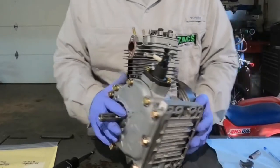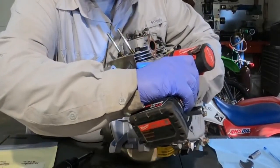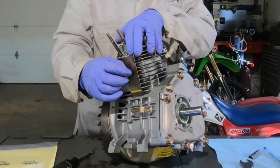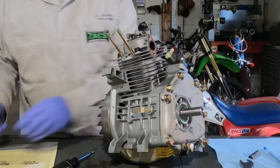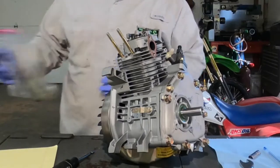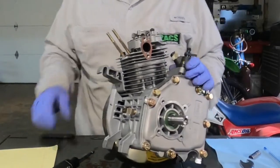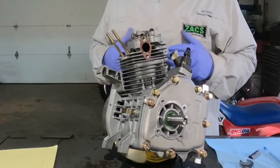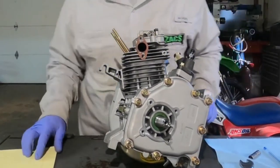Injector-side air shroud — that one also is 8mm and it just has one fastener left over here on the side. The other fastener was in the main fan shroud. I did go ahead and put an arrow on here just as a quick indicator which way's up. I've had some pretty extensive machines apart in this shop. It is just such a good habit to get into doing these bags. I've gone into Goldwing motorcycles, torn the engines completely apart, transmissions completely apart, and I've had 300 bags, 200 bags — but it really makes the reassembly process so much more enjoyable.